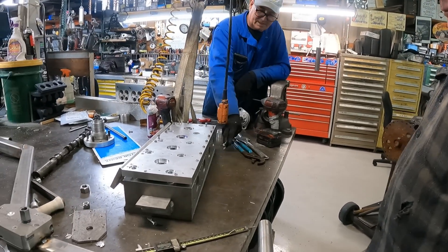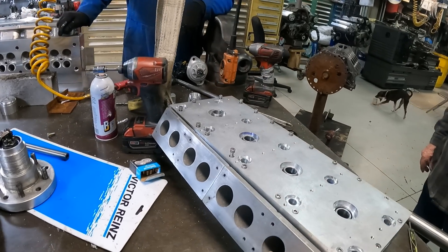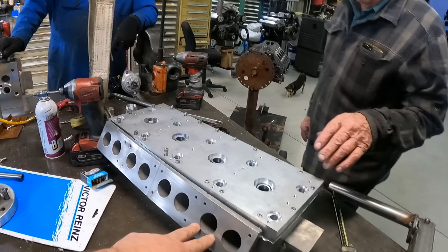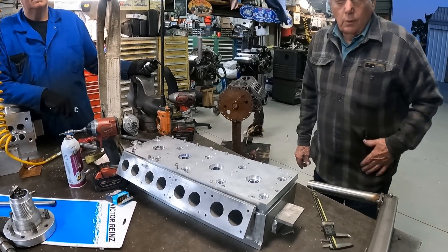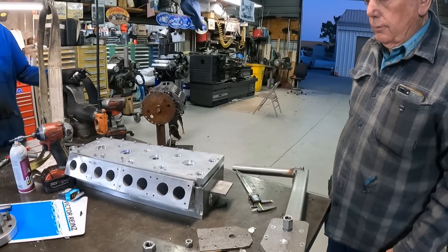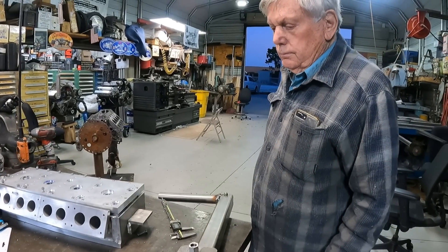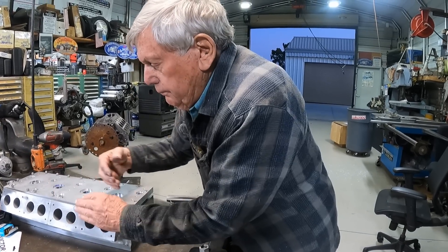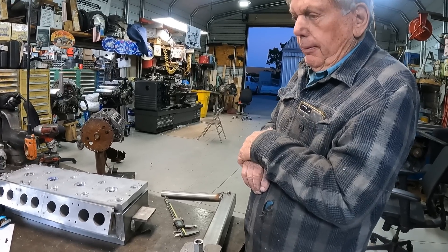On the intake side here — are you using a special throttle body or intake, or do you have to make it? You'd probably have individual runners. So you'll have eight on each head, eight individual runners? We'll probably do it like with the IRL — one oval butterfly or something. It's a body like here with the butterfly, eight of them. But you don't know what that throttle body is yet, right? No, we'll probably have to make it.